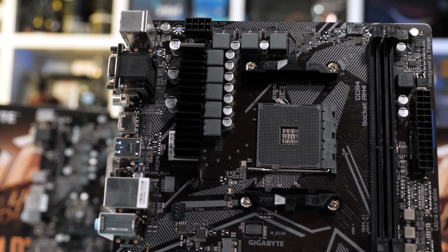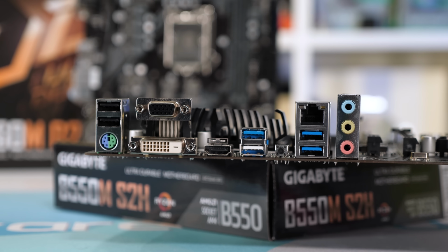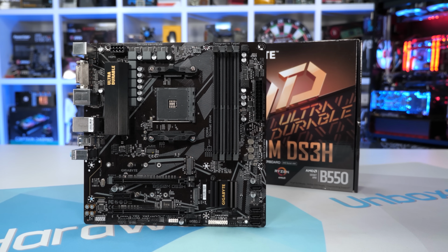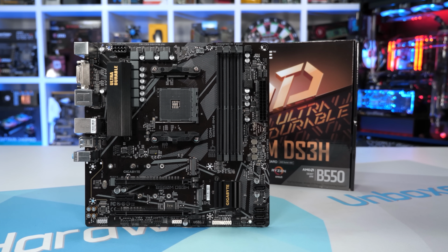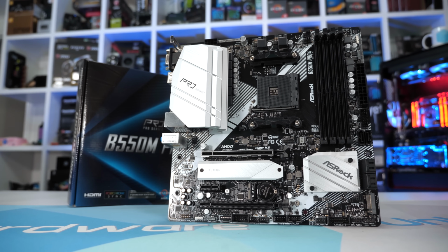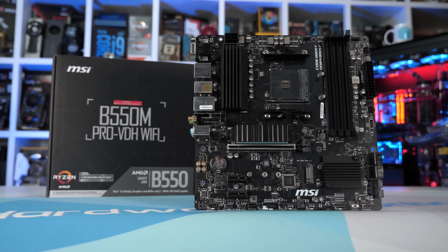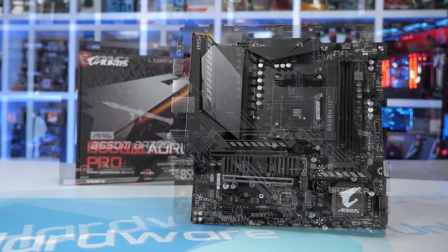Having said all of that, I've cleared around 30 B550 motherboards to work with the 5950X for extensive all-core workloads, and this includes boards as cheap as $90 US, and really any model priced at or above $120 will work happily with the 16-core processor, while delivering performance that is comparable to the top-end X570 motherboards. I suppose what I'm getting at here is, you can buy virtually any B550 motherboard, and then stick whatever AM4 processor you like on it, and not have to worry about whether or not you're getting maximum performance, so the level of performance that you should get.